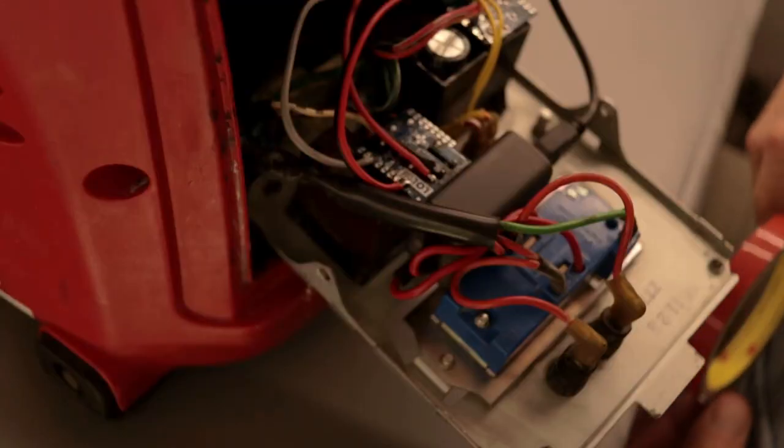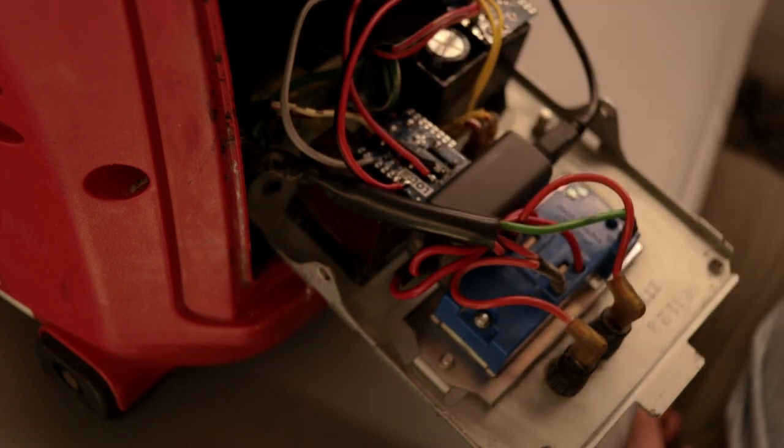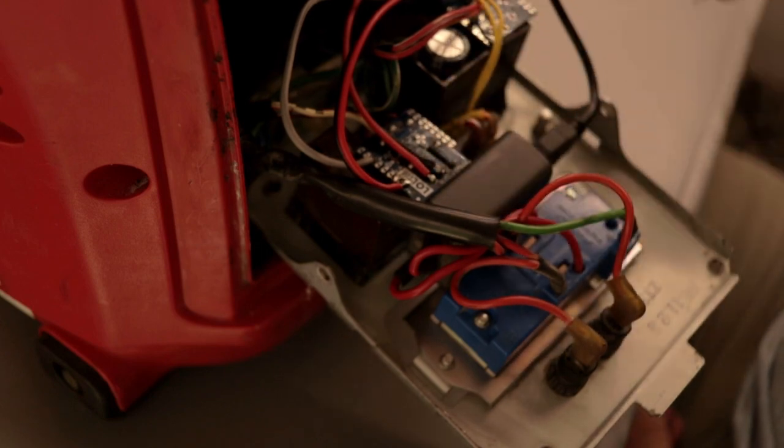I could just power this by plugging in a USB and running the wire outside and plugging it into the front of the generator, but that's for chumps and it won't fit inside my side compartment door. So I'm going to put it inside. I've cut the terminals off the wall adapter and soldered some leads onto it with heavy shrink tubing to insulate it well. On the back of the outlet here, there are push-to-connect holes common on household wall outlets and those just jam in there. There it is, kind of put together using 3M VHB two-sided tape.